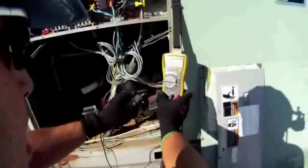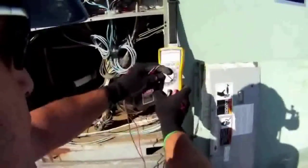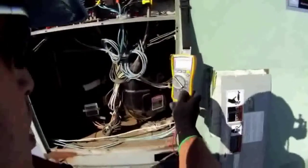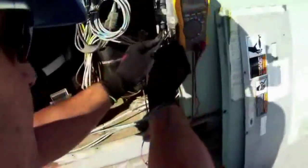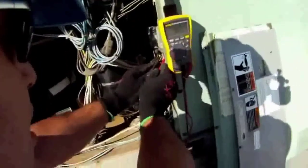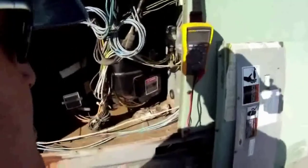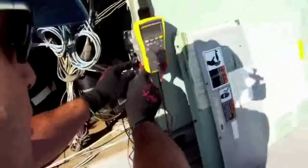The next thing I want to do is check this capacitor. I'm going to go down to the proper scale, which is the capacitor scale, and the unit is going to give me a reading in microfarads. Hooking my leads up across the spade terminals, I can see that I have 7.67 microfarads — and that's exactly what I want. This capacitor is rated as a 7.5 microfarad, 370 VAC capacitor. I'm looking for 7.5 microfarads, and just another check here — I've got 7.66. That tells me that this capacitor is in good shape.